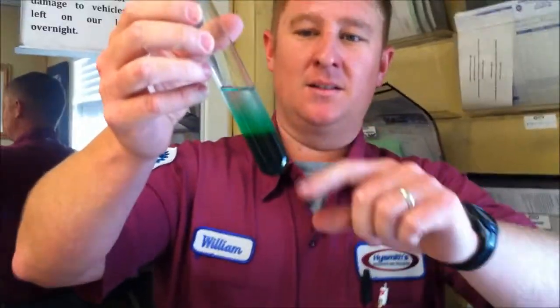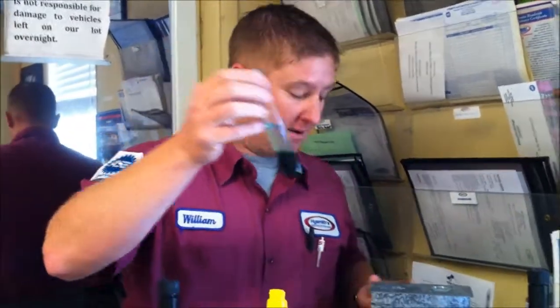As you can see what has happened is the fuel has separated back out, and in the bottom of your tank you have all of this water and HEET. It did not work to actually cause this water to get into your fuel and take that out. It's still in your fuel tank, so the bottom of your tank has all of this junk in it now.